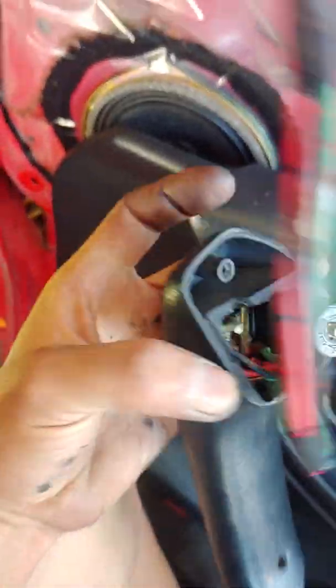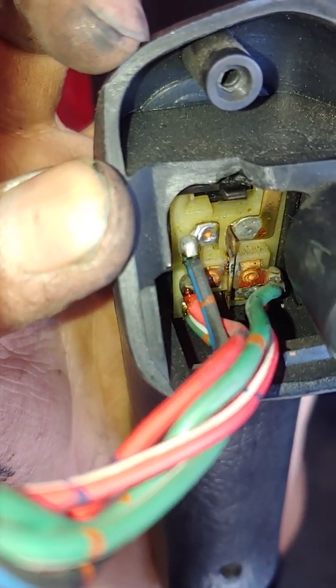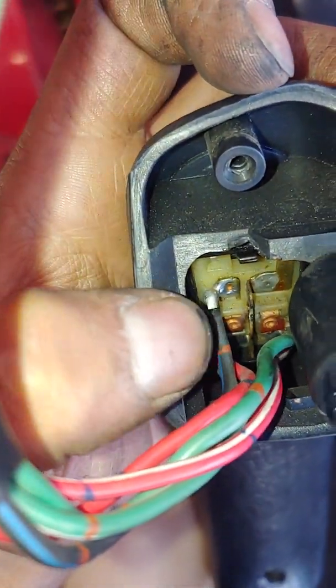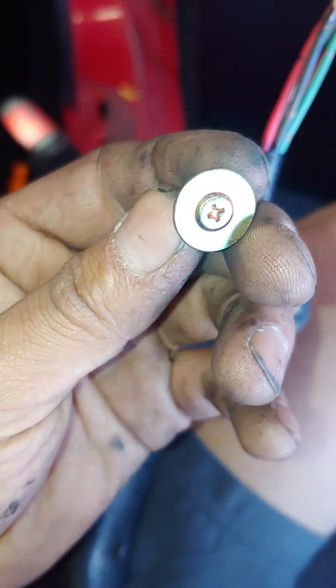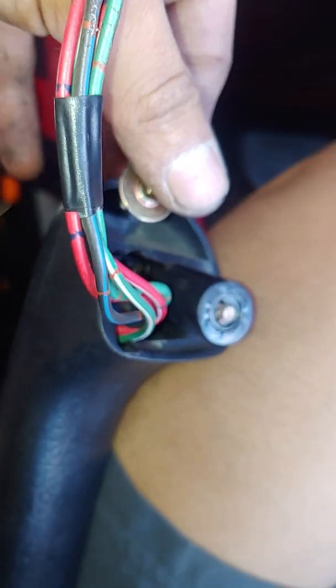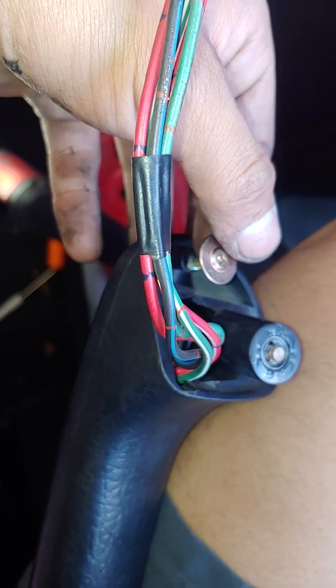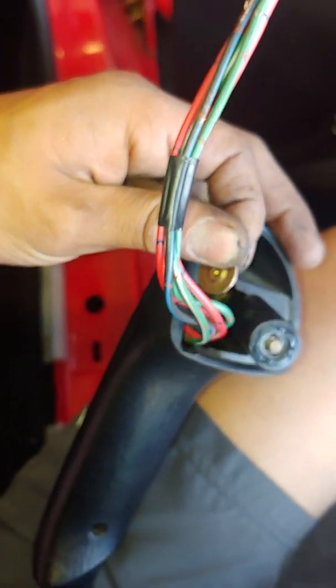As I came down, there was something shorting out two cables, the green right here to the blue and black right there. And something that I found to be very odd, out of all the electrical jobs that I have done, this, which seems to be a Mazda screw, goes mounted like so. And I mean, this is a 93. It came out and it fell in between those two wires and essentially was making the contact.